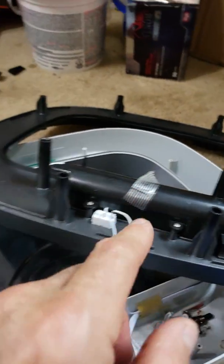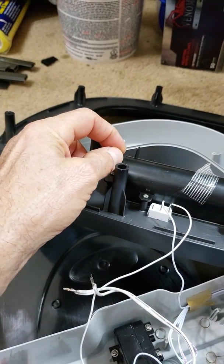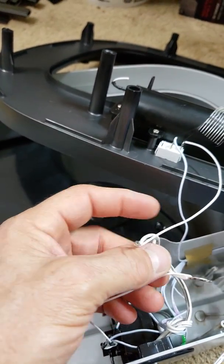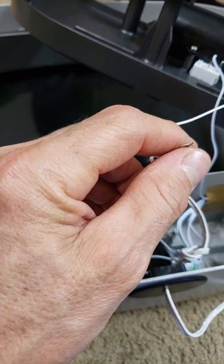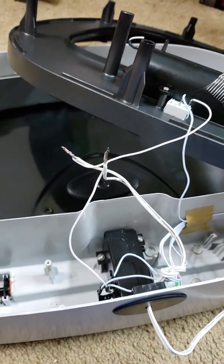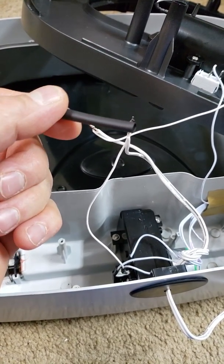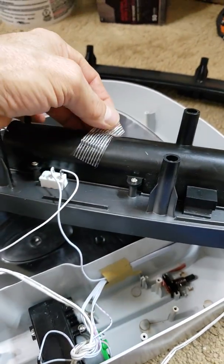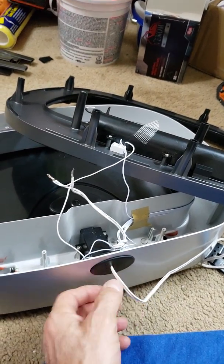Just flip it over and take a look. Snip those wires leaving a little bit of length in case you ever want to hook the batteries back up and remove the transformer. Tie your leads off — I always solder these small leads. The problem with really thin wire is it can unravel itself, so solder them down. I'll use heat shrink material — this is called Scotchcast, originally invented for the telephone company — to protect these connections. Then I'm going to tape them back down to the bottom side of the housing and screw it back together.